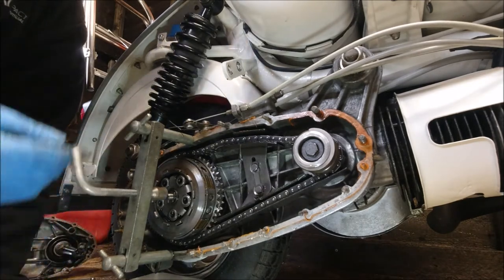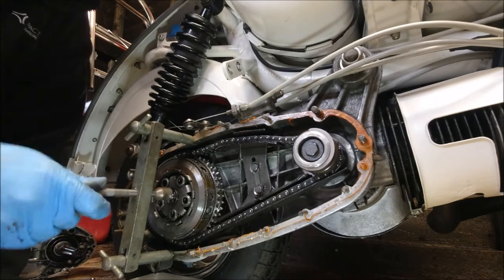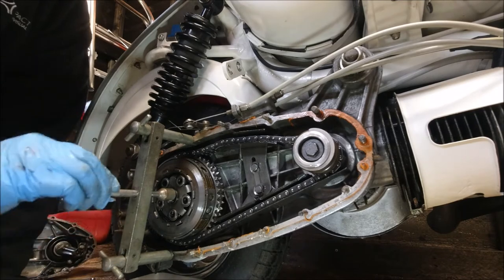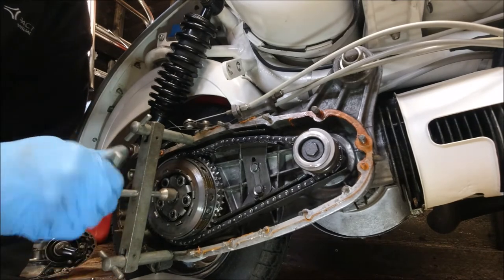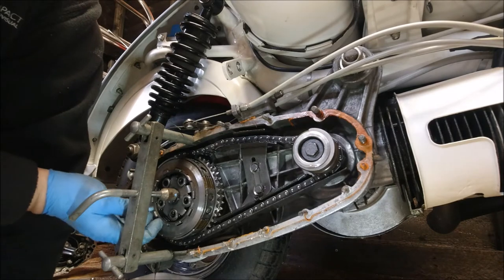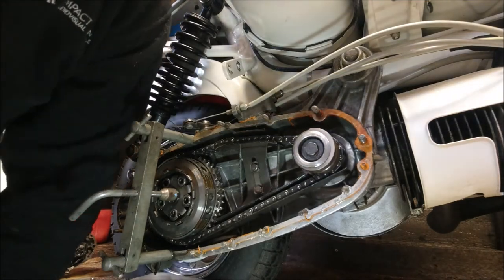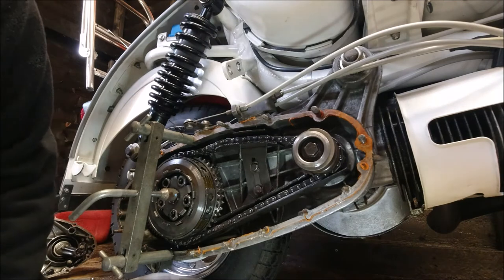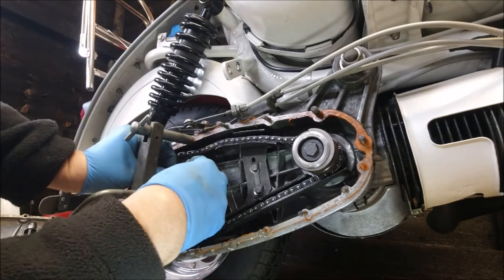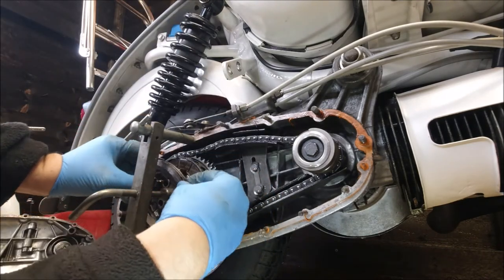So tighten up the nut if it's in line. Yeah, that's doing it. Doesn't need turning a great deal, about two or three turns will do, just so that the circlip's movable. I'm just looking for where the join is, and I can't see it. Ah, dear. There it is there. So I'll just unclip that slowly. That's it. And of course it would fall in the oil, but there's your clutch plates.